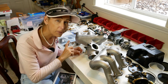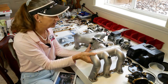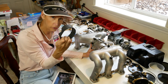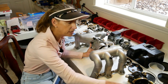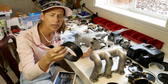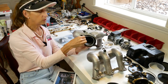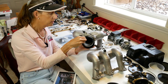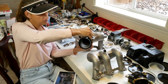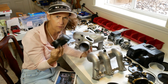Our first step is to get our intake manifolds remated back together. I've got a new rubber coupler here to fit this thing. Interestingly, this is the original and it was fine - didn't have any cracks or anything - but weirdly it doesn't fit anymore. It's wobbly and super loose; I wouldn't be able to get this thing really clamped on properly.